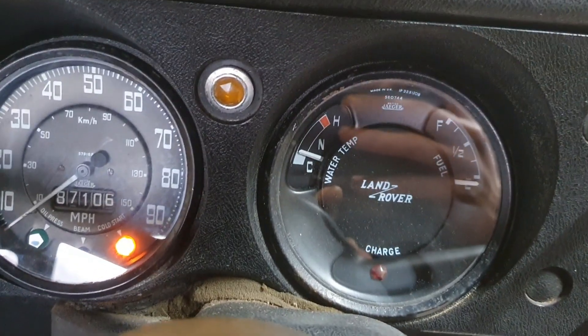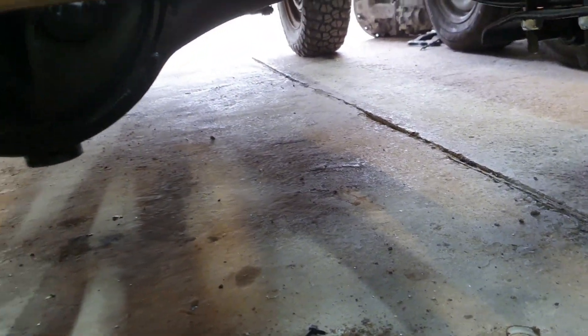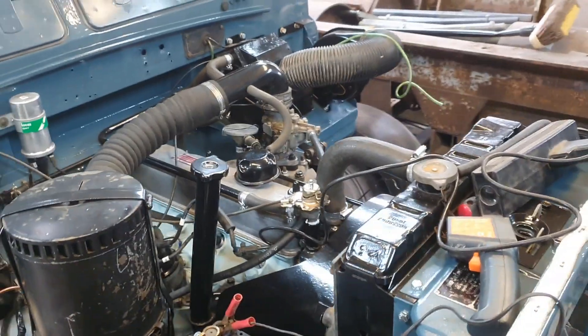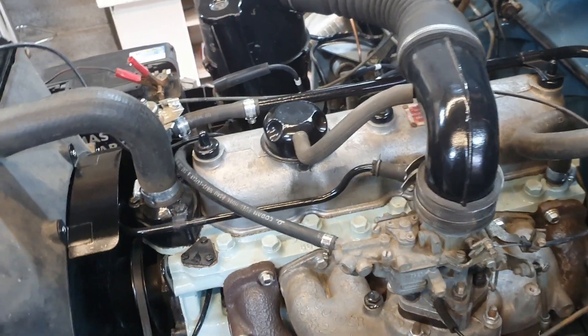I'm looking forward to hearing it idle. It's very revvy, but it's a good idea for the camshaft apparently. Temperature's just coming off cold now — we can check that with this. The oil pressure looks good. We're getting warm and we're at 45 psi now at 2000 rpm. The only leak is oil coming out of this terrible connection here, which will be swapped out at some point. She's absolutely sweet, I'm so chuffed. I've got it down at 750–800 rpm now, had a 20 minute warm up. The oil pressure is fantastic — 40 psi hot idle. Fantastic oil pressure.